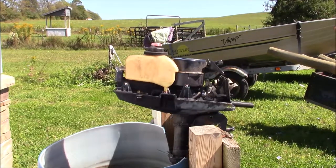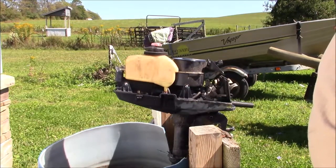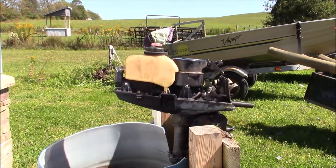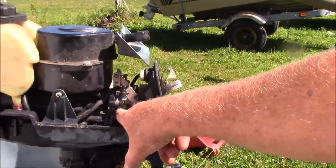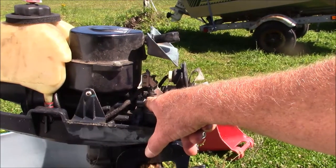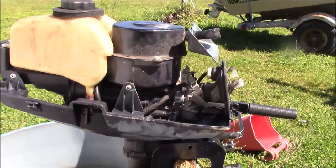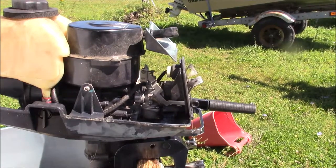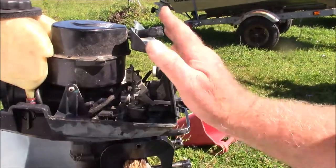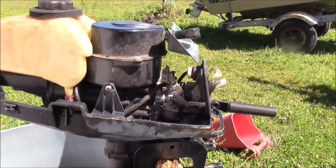I'm going to pull the little rubber hose that goes to that little rubber nozzle down there that kind of blocks off total flow, so you can have a telltale versus a big hose. A couple of things very interesting about this - to you motorcycle people, do you recognize that it's like a mini Mikuni where it's a slide-type carburetor? Instead of having a throttle cable you've got this lever that pulls a slide up and down. There's a needle jet, a needle valve, a main jet, an idling jet - all the things you'd be familiar with. On the other side you have a choke - it's just a flapper that shuts off the end of the carburetor. Gravity fed, so you don't have to worry about fuel pumps. Very, very simplistic motor.